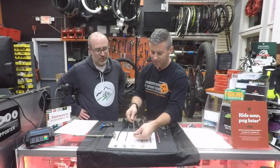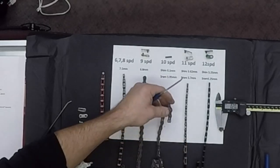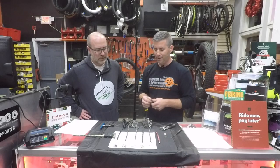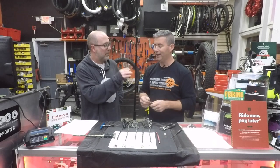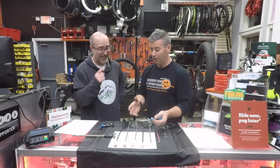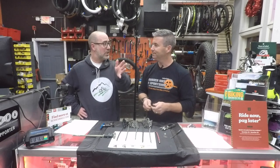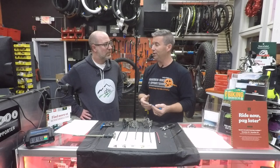The links themselves also have different shapes, which helps with strength and the pickup of the chain as it shifts to easier gears. People will take the chain off, wash it, put it back on backwards, and wonder why it's noisy and rough — chains on backwards. Almost all Shimano chains from about 10 speed working their way up are directional, and that's stayed the same. Anything Shimano you have right now is probably directional. The easiest way to tell: one side has print, the other does not.